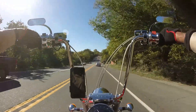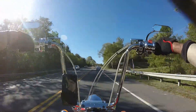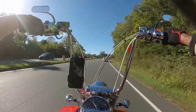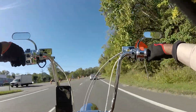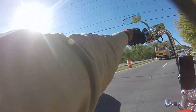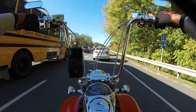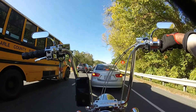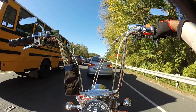As far as the belt drive — I'm changing it from belt driven to chain driven, because when you start adding torque, you want to get away from belts. You'll shred them — there's too much torque. So I'm beefing up the motor, which means you need to beef up the transmission, which means you need to beef up the suspension, which means you probably need to beef up the brakes. I haven't done much research on the brakes yet, but I've seen some upgraded calipers — they were like a thousand dollars for a caliper. I'm not scared to spend money, but I'm already stretched out pretty wide with what I'm already building.